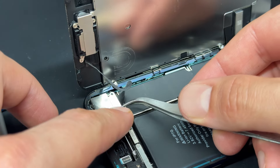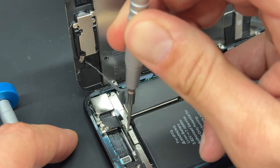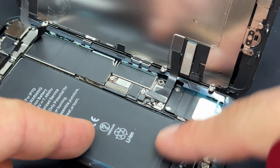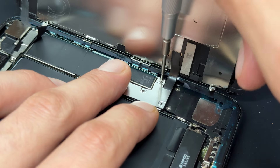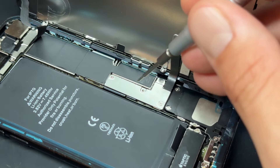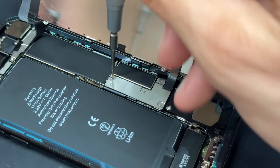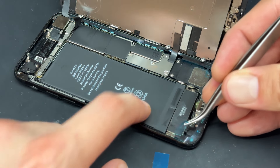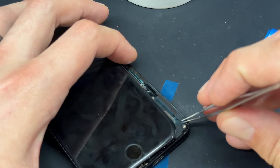Whilst we're up at the top end, we can re-secure the shield into place and screw in the two crosshead screws that hold it down — make sure they're nice and tight. Now we'll move on to reconnecting the battery, and we shouldn't have any problems lining it up because we lined it up properly before. Then install the shield on top with the tri-wing screws — the longer of the four screws goes on the far edge because it goes all the way through the board into the chassis, so make sure you don't put a long screw in either of the others. Now peel off the remainder of the dust and moisture resistant seal — you might find it comes off in three pieces, and it's easiest to get the back piece off if you fold the screen down first and then peel from the right side.